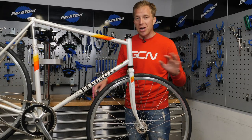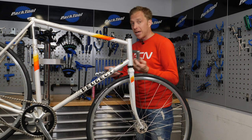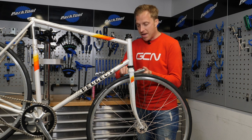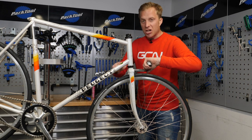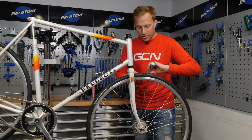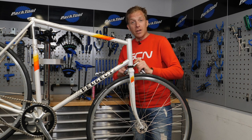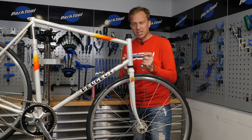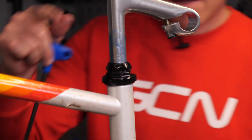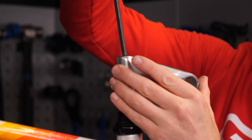You can see now I've put the front wheel in place, and it's time to actually get our steering sorted out. The stem — the traditional quill-style stem — is going to be fitted into the steerer tube here. Once again, you know the regime by now — I'm going to put some grease on the actual stem and also down there on the expander bolt too. These used to have such a tendency to become stuck in a frame, or rather forks. I remember a friend of mine putting his forks in the grate of a drain trying to bend the bars out of place, and he ended up snapping his forks. His father gave him a right telling off that night. So we'll put it in — doesn't have to worry too much about how lined up it is, but get it in the ballpark place then. You can always adjust it later once you've actually sat over the bike.